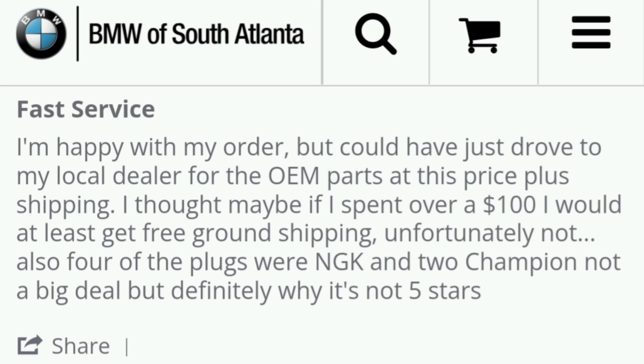The other thing is BMW used multiple suppliers for their spark plugs. Sometimes they use NGK, sometimes they use Champion. And if you order 6 spark plugs directly from BMW, there's a very good chance you're going to get a mixed batch. So you might get 1 or 2 NGKs and then 4 or 5 Champions or some different mix. It's very common for them to carry all of them at the same time. And if they just grab them off the shelf, you're not really sure what you get. So with all that in mind, I highly recommend ordering directly from the aftermarket company that makes your spark plugs.